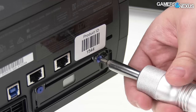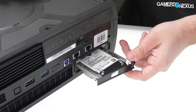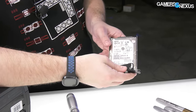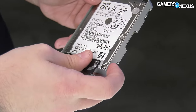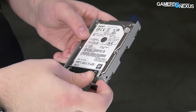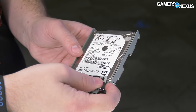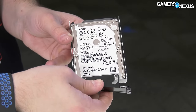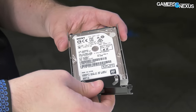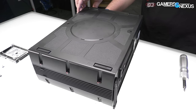A couple of Phillips head screws with blue heads make them easy to remember. Loosening those two gave us a small lever to help remove the drive bay, which revealed a hard drive in laptop form factor — a 2.5-inch drive. It's not an SSD; it's an HGST drive, one terabyte at 5400 RPM, and it's actually SATA 3 gigabit per second — not even SATA 6 Gbps. Compared to the normal consumer PS4 Pro, this drive appears to be the same standard stock unit.